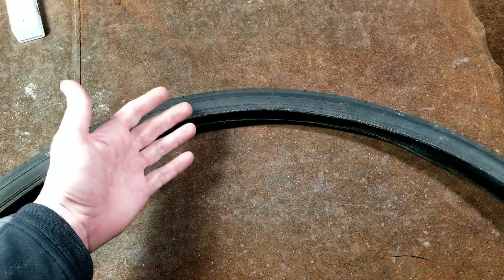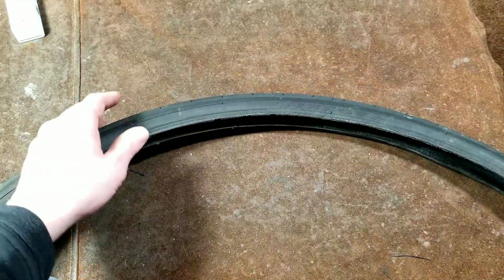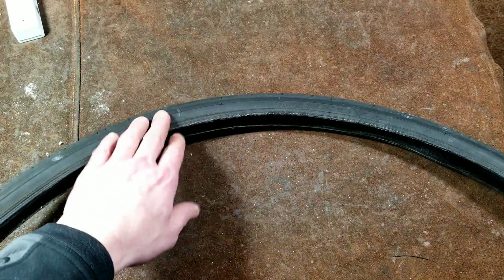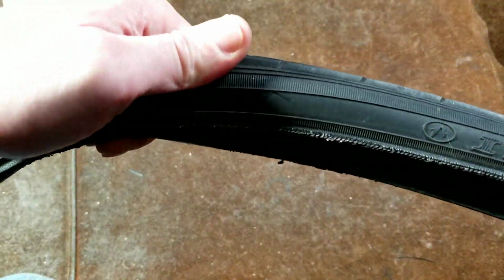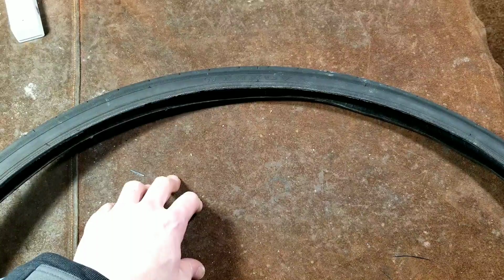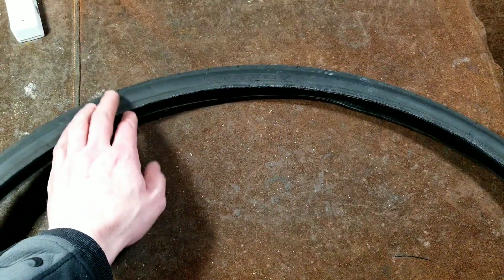When tires are made and the rubber compounds are put together, they are put into a mold, a big mold, just like they manufacture any plastic item, but it's the whole tire. It's a very complicated and expensive mold. The fiber reinforcing is placed in there, and then they inject the rubber, and that's what all these little bumps are. Whenever you get new bicycle or car tires, those bumps are the little nozzles, the little holes where they inject the rubber in. And then it is under both pressure and heat that causes it to set, kind of like a type of adhesive or epoxy or glue, but this time it is heat and pressure.